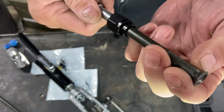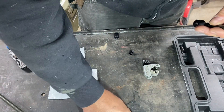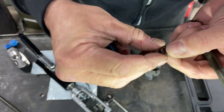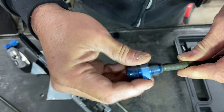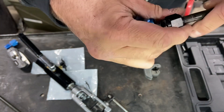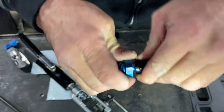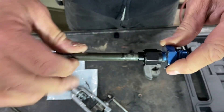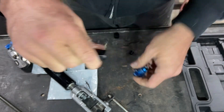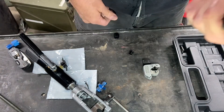I went through and remade that flare, and you can see it's a little deeper than what the first one was originally. So that's what the first one looked like — and that's what the new one looks like. You can see it fits much better on there. Now you slide this down and you can screw it on, tighten it down, and there's your good fuel fitting. You obviously want to tighten it down when you get it on the system. That's just another type of flare for fuel line fittings to adapt to AN fittings on the hard lines.